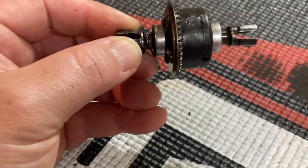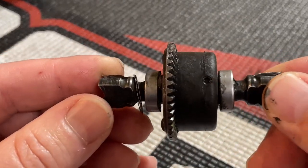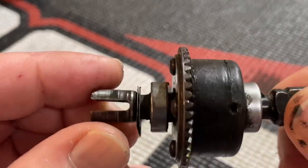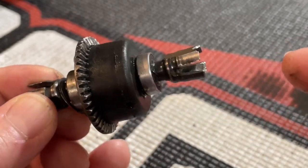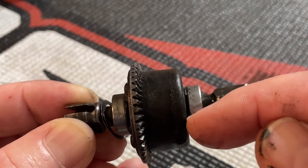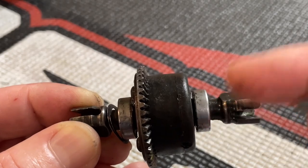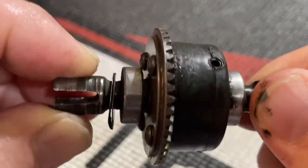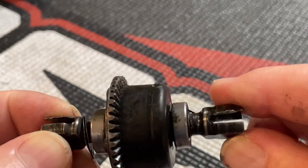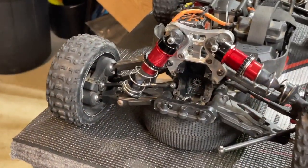If it's not a matter of clicking and grinding but you're only getting power to one tire — one is spinning and the other is spinning free but your dog bones didn't pop out and nothing else looks weird — what has most likely happened is a pin broke inside. Behind these drive cups there's a big sun gear and there's a pin in there that locks that sun gear in. If that pin snaps off, everything will look fine on the outside, but underneath that sun gear the pin is broken and that's why you've lost drive to that wheel.